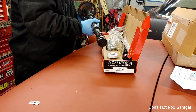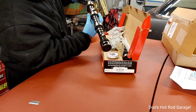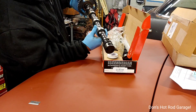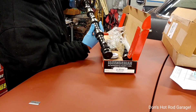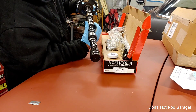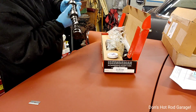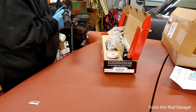That's all good, checking out real good. But this is the original one, and you can see the shininess as it gets to the ramp — that's wearing through the original heat treatment that GM put on them. It actually gets to the point where it starts to flatten the cam lobe. You can see this lobe right here isn't nearly as defined as that one, so it was starting to have camshaft failure, among other things.